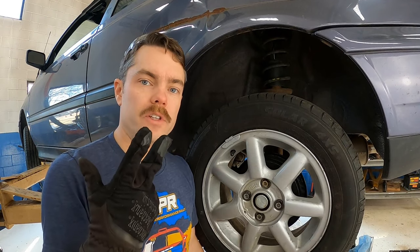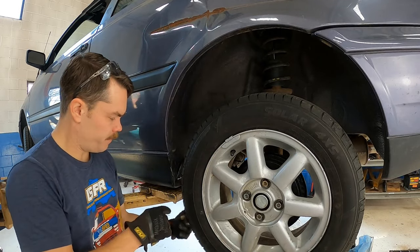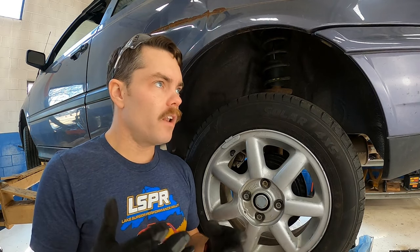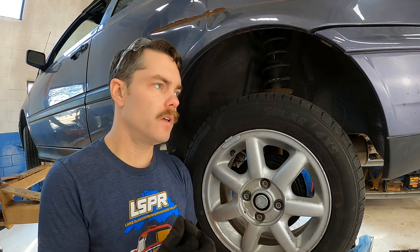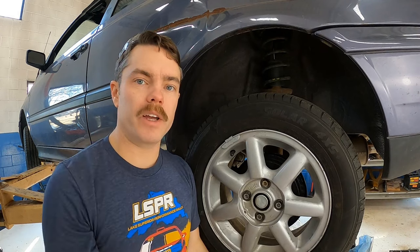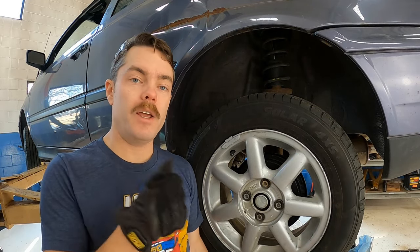Looking pretty good here. I have to hook up the new hose. I have to figure out how to make the line fit there, maybe make a little extension in there, and then I have to work with the wheel speed sensor, this ABS sensor that apparently was on this car, maybe on the old backing plates, but I didn't know. And it looks like I got a spare parts axle that did not have ABS, even though it's 2 years newer. So I have to figure out what to do with the ABS thing, but in the meantime, I'm going to move over to the other side. I'll do all this drum brake conversion stuff, try to get this done in the next like 2 hours before I have to actually start work, and just tie this ABS thing up for now. And we'll have a car with an e-brake, and we can roll it outside and stop it in the yard.